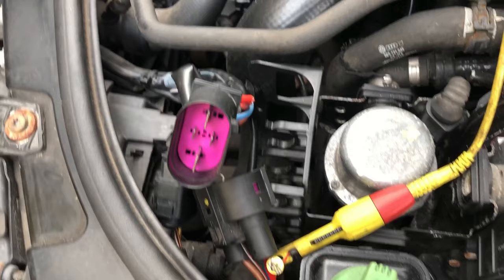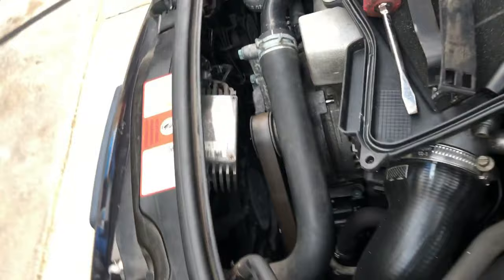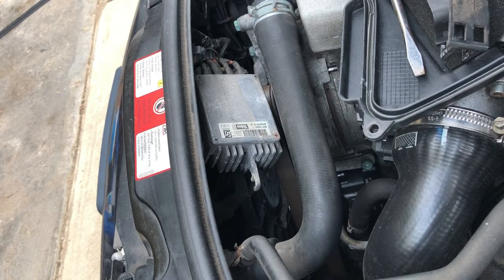As you can see, the cooling fan ran with the control wire completely unplugged — nothing was telling it to turn the fan on. The only thing this can be is a faulty cooling fan control module. It's actually a pretty common failure on these Audis and Volkswagens. I'm going to get the new one put in there — that'll fix the problem.